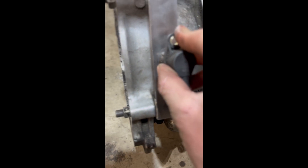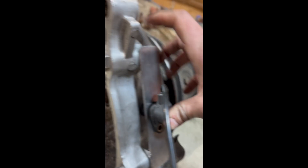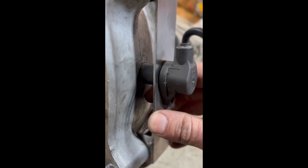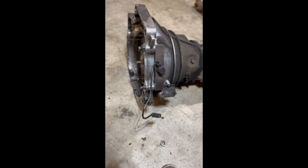You bore out the hole, then keep boring it out and checking it with the crank angle sensor itself until it fits snugly into the hole. I have made these as nice and tight as I can — the crank angle sensors might be a little stiff pushing through, but not too tight. I wanted them to be nice and snug. I have them already spaced to where they need to be when you mount them, but you can push down on the bracket ever so slightly to bring the crank angle sensor into the flywheel if needed, or vice versa pull it back out. And that's that for the crank angle sensor bracket.